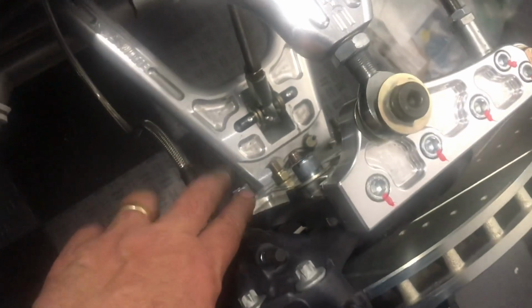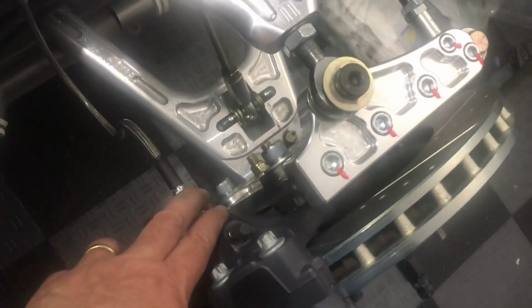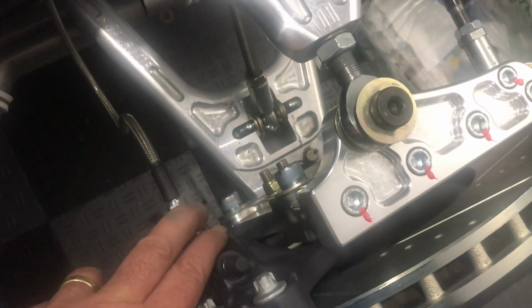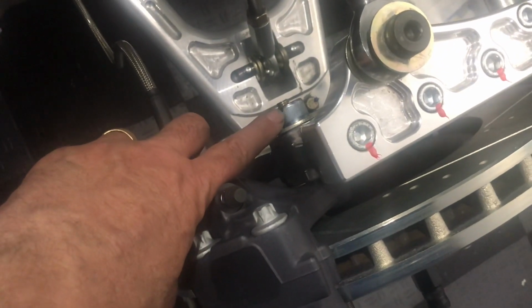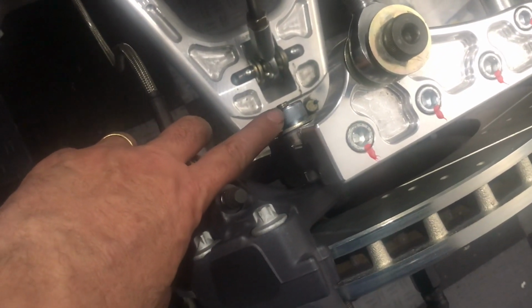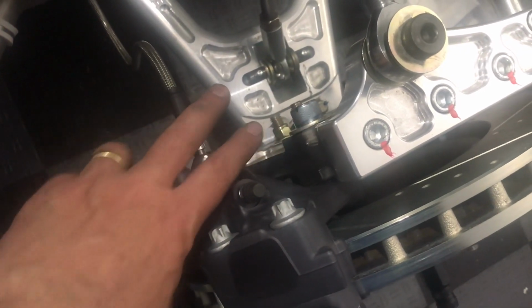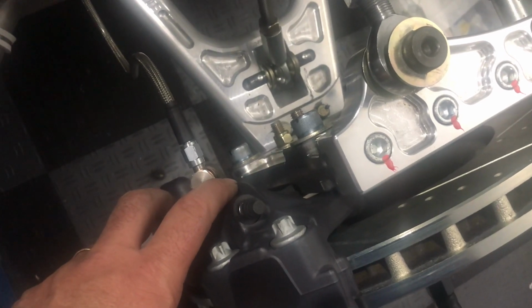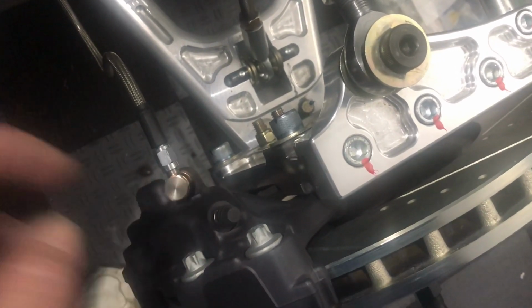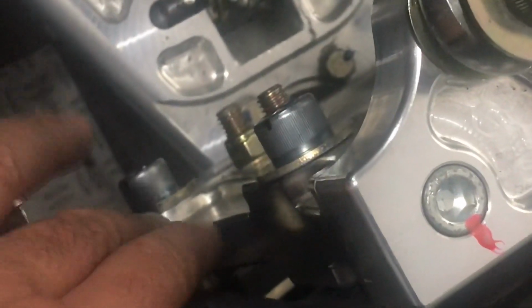The other thing is, I torqued these bolts up to 95 foot-pounds, and I did find the specs for a 2010 Camaro SS, and they actually use torque-to-yield bolts. And they say to torque these bolts to 44 foot-pounds and then an additional 90 degrees. Now, torque-to-yield bolts are single usage, and they stretch. And these are actually 12.9 bolts, and they're not going to stretch like torque-to-yield.